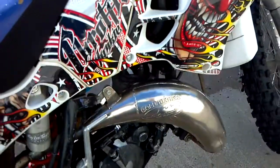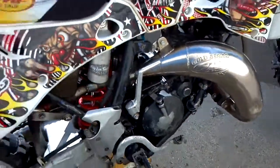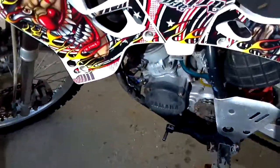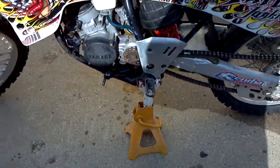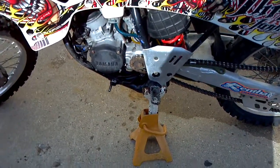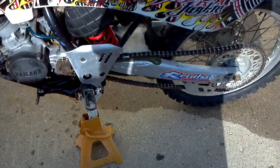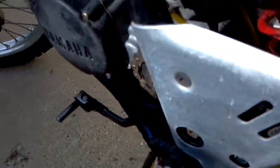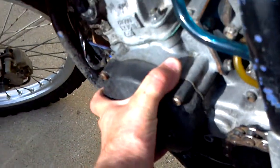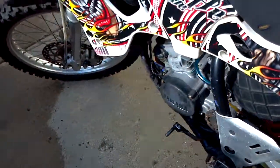And another thing that I fixed. This man, every single engine mount was loose. You know, I kept on wondering why it was just rattling so bad. Not like rattling, but vibrating. And pulled on a chain like that, and the entire damn engine was moving. I could literally shake the engine on it.